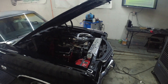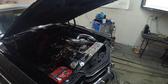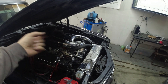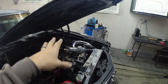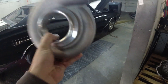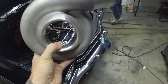Dropped about 20 horsepower. One thing to realize is we're trying to give the non-air-filter tests the most advantage as possible. Realistically, with the hood shut and driving around in the summertime without the air filter, you're going to have much higher intake temps going into the blower and less dense air charge. We're doing as apples-to-apples a comparison as possible. Now we're going to take the old housing, toss it on there, and do the same series of tests to see if there's any actual difference between the two.